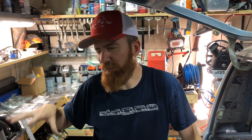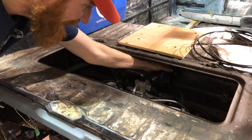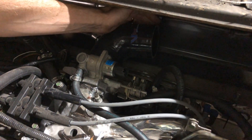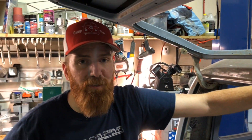Save yourself a few bucks — the throttle body reverser is around $300 American, and I believe this kit was £65. I have about an inch clearance between this air intake elbow and my gas tank, so there you have it: split window bus, not required, easier install, more clearance.